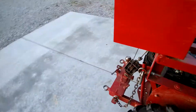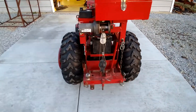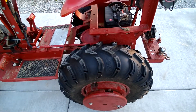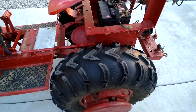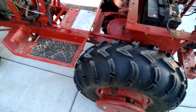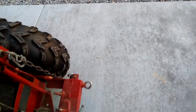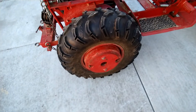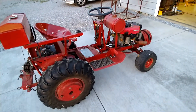These are pretty good-sized tires — four-wheeler tires I bought brand new. They're completely filled with windshield washer fluid; about 10 gallons per tire. I've also got about a hundred pounds of cast iron on each wheel. I did not realize how heavy those were just putting the wheels on and tightening them down before loading the cast iron weights, but there it is — all done.